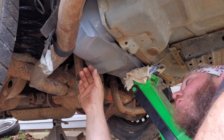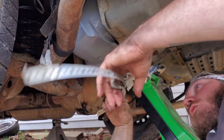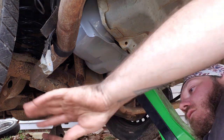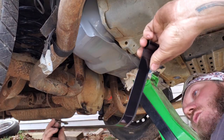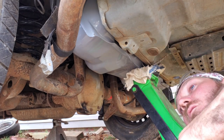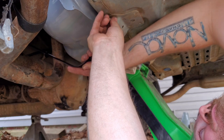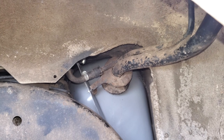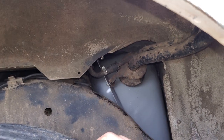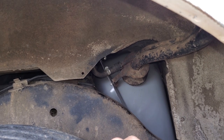We got our fuel tank up in place — it went up pretty good, literally just straight up, slowly jacked it up to the jack, everything was good. We're going to get our new gas tank straps — the owner was gracious enough to get some new ones. I'd honestly prefer old ones because they're already contoured, but I have a pretty good feeling about these. We got our filler neck all back in there, all bolted down. Got our little emission hose on. I did tell them to order a new piece for that because that is not going to seal. That little screw is still loose — I'm taking this tank right back out of the car as soon as I get back down to my shop, so I'm not too worried about that. But everything else is good and tight.